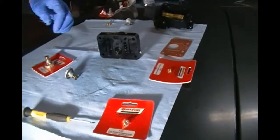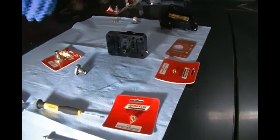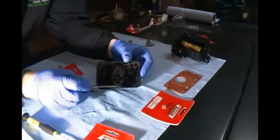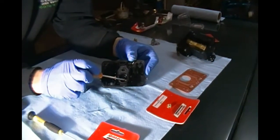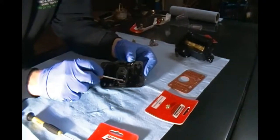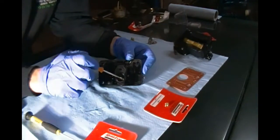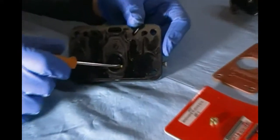This was very common with my power valve too - my factory power valve did not have a marking on it. You can check them with a vacuum gauge and just produce vacuum with a little hand pump and see when it opens up. The factory one was actually a 4.5, which is for a pretty aggressive cam. It's a pretty aggressive carb - it almost seems like you're detuning this carb a bit to match your engine. It came with like a 74 primary jet and an 84 secondary, which is a fairly big spread, on a 750 CFM carb.